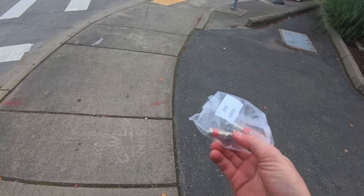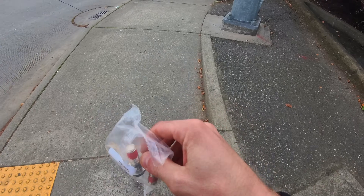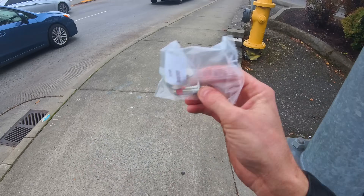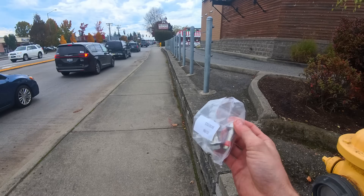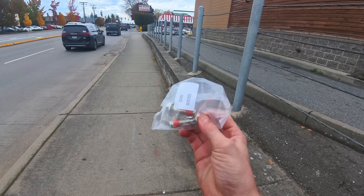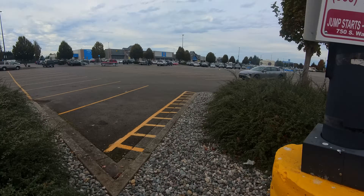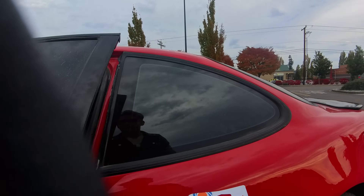This means I still need to go to Walmart for a jack and jack stands and all the stuff to lift my car up, but we got the bolts. The mistake I made — when you get new bolts, they've already got thread locker applied. You can see that red stuff right there. So this doesn't actually need anything new — I can just put this in. But when you're using the same bolt like I was doing replacing my rotors, you need to reapply that stuff, and that's what I forgot to do.